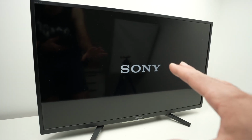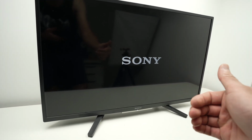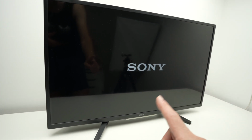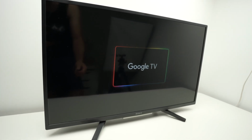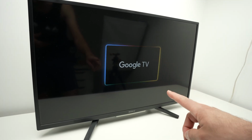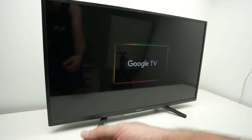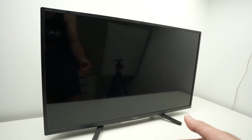And after the TV turns on and you see something on the display, okay, this is great news. Connect one by one each device you have previously disconnected in the back. So connect your first HDMI cable, check the TV screen. If it doesn't turn black, go ahead, connect the second one. And just like this, you're gonna find what device was causing the problem.